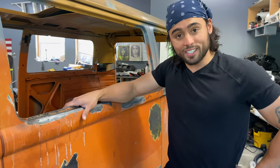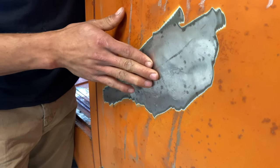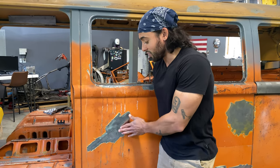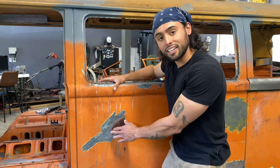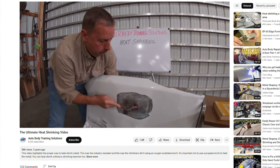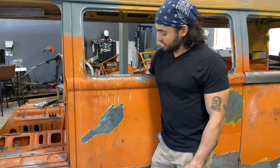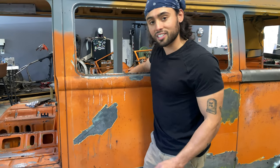I'm not classically trained in body work, so I had no idea what that was called, but I knew it was a problem. I looked it up and it turns out they call it oil canning, and it can be caused by hammer and dollying so much that you stretch the metal. I did my research, and one of the solutions is heating up a little cherry in the center, smacking it, and kind of shrinking the metal by moving it towards that soft spot, then cooling it with a wet rag. So we're going to give that a shot, and hopefully this mistake I made can teach you guys a valuable lesson in body work.